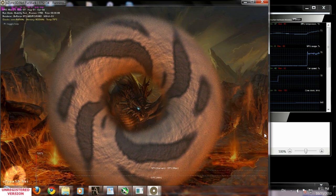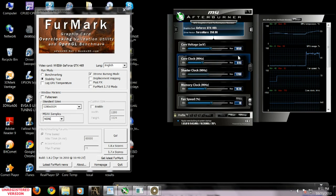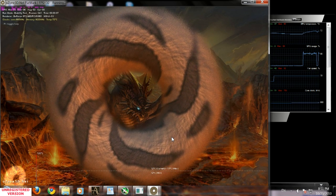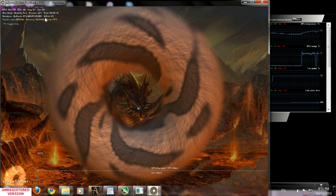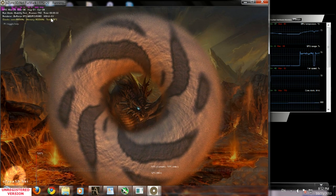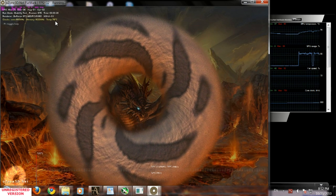I'm not gonna wait 20 minutes — I already know my frequency — so I'm gonna click stop the test and increase by 20 megahertz more, then run the same test. I'll keep doing so until the image fails, behaves differently, shows some artifacts, or freezes up. Over here we also have the GPU core information, memory core and memory frequency, and the temperature on the GPU.